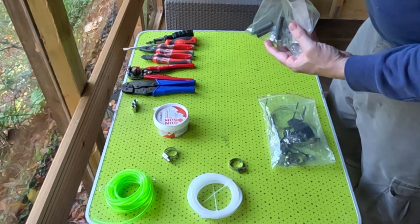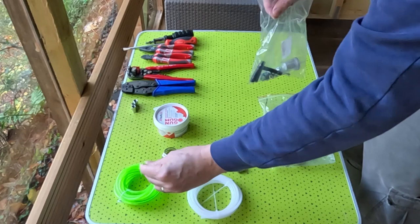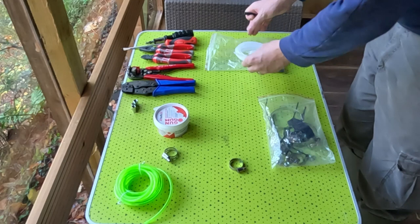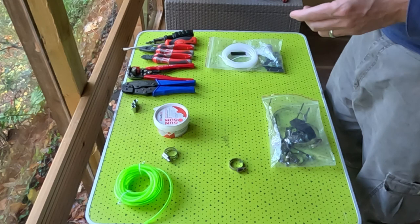And they come with these connecting bits of rubber. And this is much easier than trying to fit this hose over the various joints. It gets very slippy, especially once you've filled the system with diesel. So alternative hose kit, and that's about that. Now I'll start assembling the heater on the bench, and then that way it's much easier to fit all the connectors together, and then I'll situate it in the corner of the summer house.